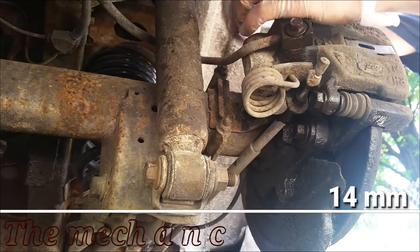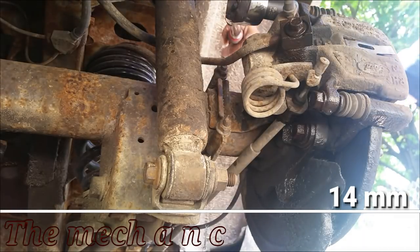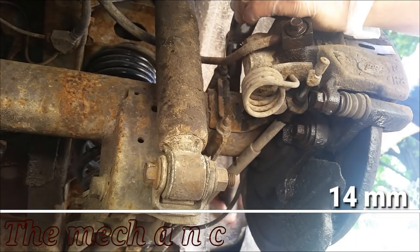If you're just replacing your brake pads on your Mustang, all you have to do is remove these two 14-millimeter fasteners and it lets the caliper itself slide upward. It's going to leave the bracket in place, but it gives you access to your brake pads and you can easily change them.